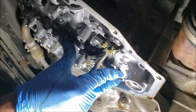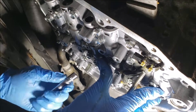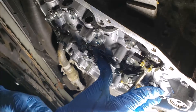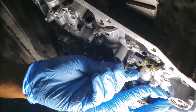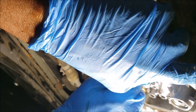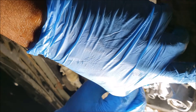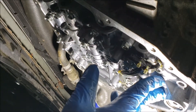Another alternative — if the car is still under warranty — is to take it to the dealership so they would replace the CVT transmission for you. But most importantly, schedule regular intervals to frequently change your CVT fluid so it doesn't end up retaining gunk in the solenoids, which would affect how the CVT operates. I hope these solutions help you in the future, and thank you for being with me throughout this time.